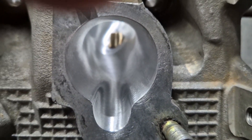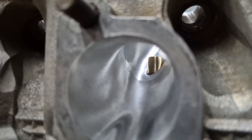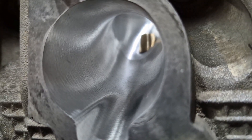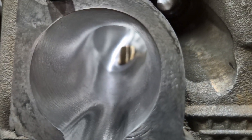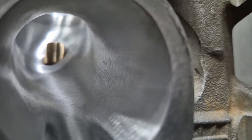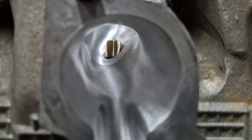This is the intake. We try to improve as much as we possibly can. And there is your rough finish for the side drafts — because we don't have the pressure that an injector gives, like three or four bar. So atomization is very important on side drafts and we have to get that right.